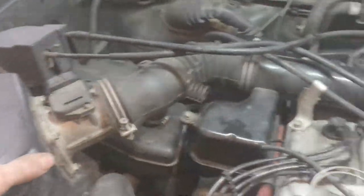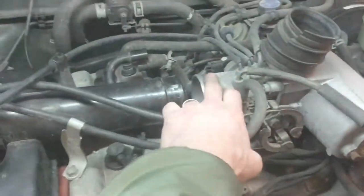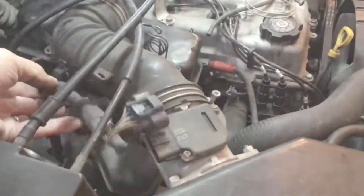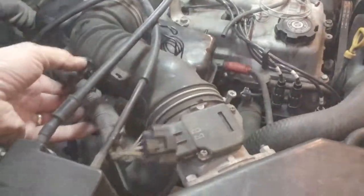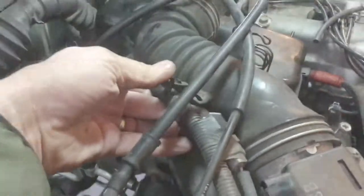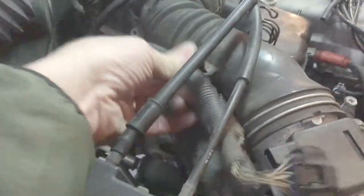What you really need to do is move this whole thing back all the way to the airbox to have room, because I want to take the throttle body off to address the sticking problem. Unclip the airbox. Your mass airflow sensor is here — just undo it, unplug it there. These little plug-ins just kind of pull out. There's a release but this thing just snaps in and you have to pull it out really hard. Worst case if it breaks you can zip tie it back.